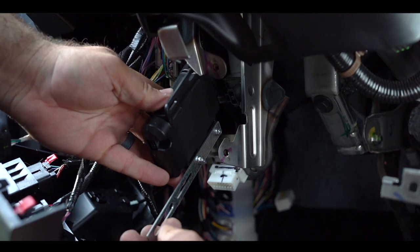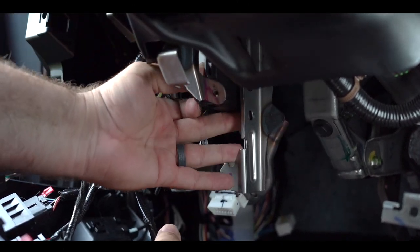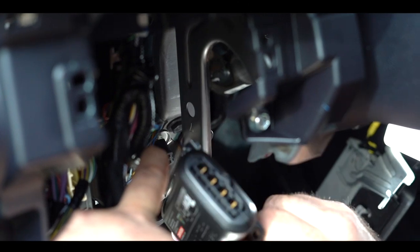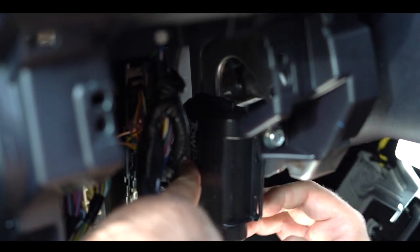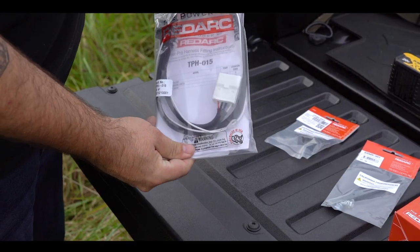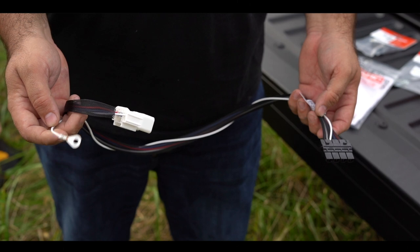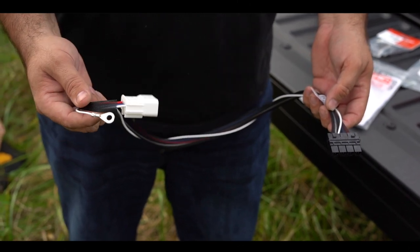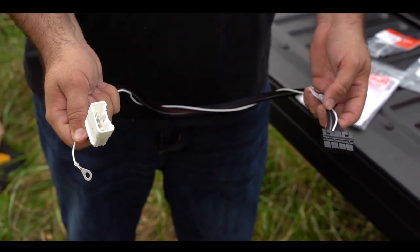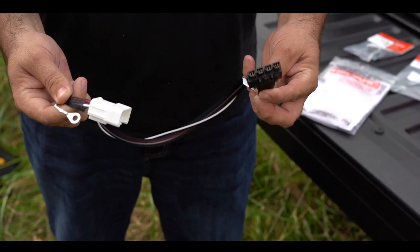Let's check it out and see how it fits without attaching the wiring first. Let's get our TowPro ready to install. The white wire on the harness will be our ground point, the white plug is the part that we connect to the existing tow package plug, and the other side is what connects to the TowPro.